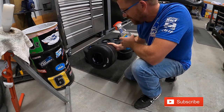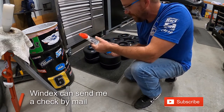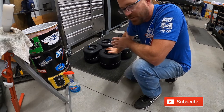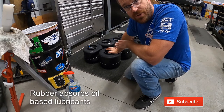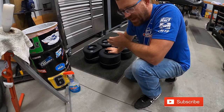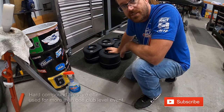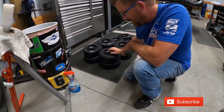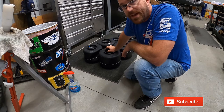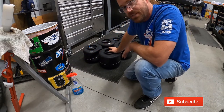It's always good to have something to lubricate the wheel. I use Windex because it dissipates — it dries out and goes away. I've seen guys use WD-40 and other lubricants; I don't recommend that at all because it makes the tire slip on the wheel, even with bead locks. It also absorbs into the tire itself. So if you're using a 206 tire or a harder compound tire, over a week's time all of that will absorb into the bead and could cause you to lose a wheel or tire off the wheel taking hard corners. I recommend some sort of glass cleaner that dissipates and dries out.